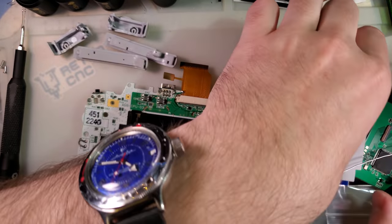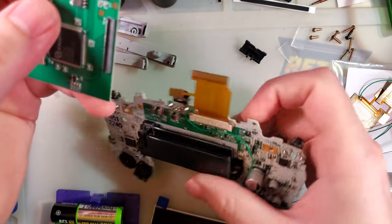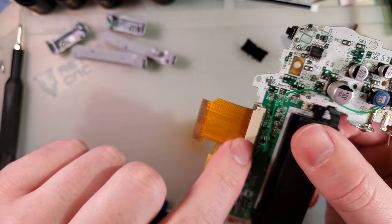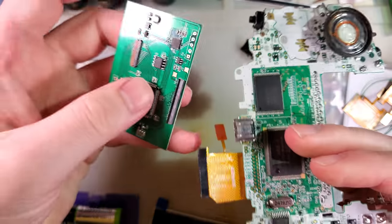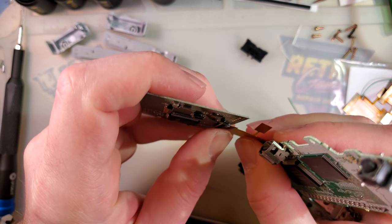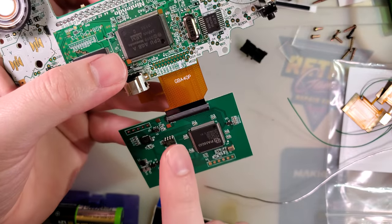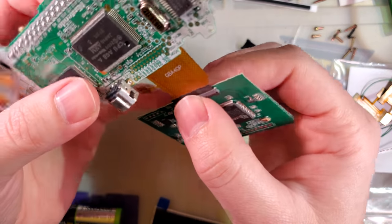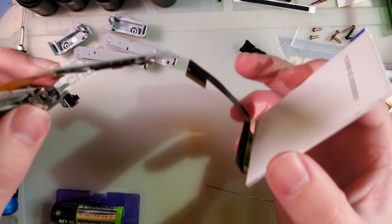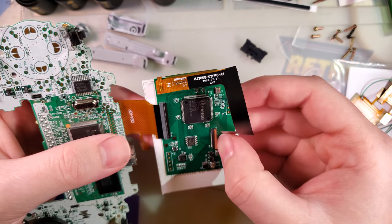What I'm going to do instead is come in and solder it to the side of the fuse that the power switch is on, so that we not only give it power straight from the batteries, but we also have the power fused just in case. Remember, fuses are safety devices — bypassing them is very silly. It's entirely possible that the kit itself is already fused, but why not play it safe? We can route that more carefully later, but that should be good enough for testing.